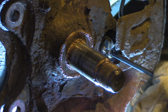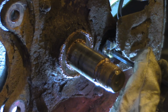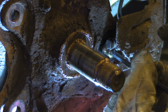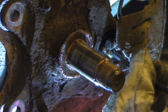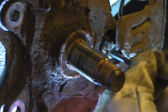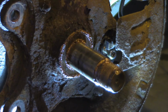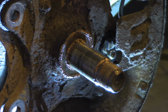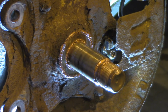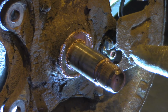When I bolt it, you see the surface is rising because it doesn't hit the exact spot on the other side. It most likely is caused by the rust or the fact that I needed to make new threads in this material, because the previous bolt that I removed was completely rusted, and actually the head just tipped off while I tried to remove it. So I needed to drill it and thread it one more time.